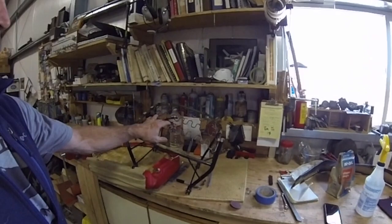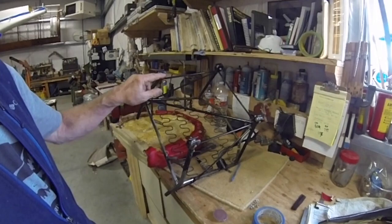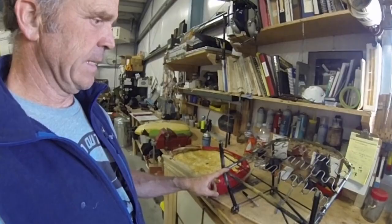I've taken my old cushions off, and this is a good time to inspect your seat as well. The AD we're all familiar with, the Cessna C-Track AD, also gives you a dimension on the width of these. This is an old seat, of course — really light. Sure enough, I was inspecting it and I found this tube to be cracked. I re-welded it, but it's a good time.